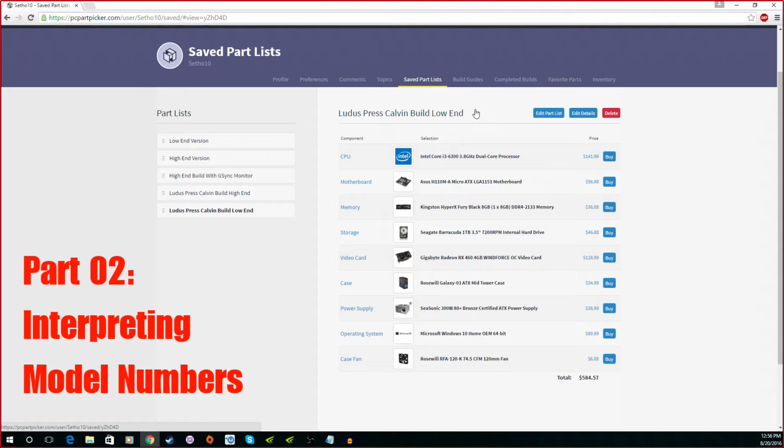You following that? Yes. So an i3 would be your low end of an individual series of processor, an i5 would be your mainstream, and i7 would be your high end. So multiple different processors of different generations and even of the same generation will have an i3, i5, or i7 designation. That is merely saying i3, this is low end, i5, this is mainstream, i7, this is high end. That's all that means. That is not the model, that is not the generation. There's so much misconception about what that means. It is merely telling you high end, medium end, low end.